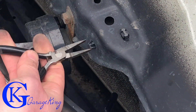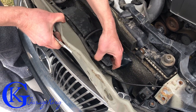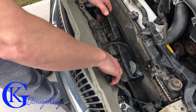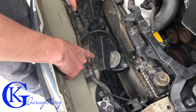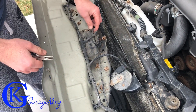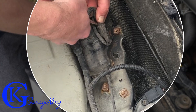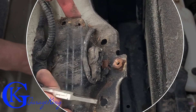Squeeze the clip and it comes off. There's one little clip in here holding on to the wire, so we pull that back and now we can get the plastic out. It does have an alarm for the hood, so this will be the electrical connection. I'm gonna disconnect this connector and then unscrew the bolts from the front and take it out. The electrical connector is out.